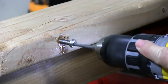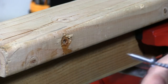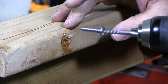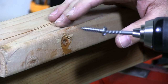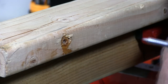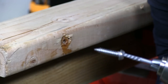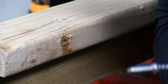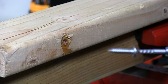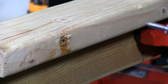There we go. That took a lot of pressure to extract that sheet metal screw out of wood. You have to drill the hole deep enough so you can get enough bite. The hole I drilled did not penetrate the other side of the screw at all.